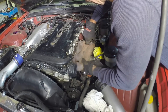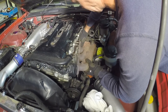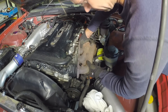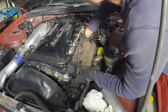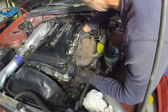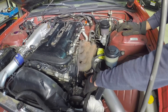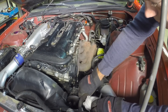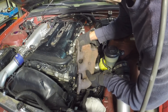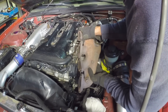Now, the entire turbo manifold and O2 pipe should slide right out, and in most cases it will. However, in my case, the added wastegate dump tube is in the way, so this was a no-go attempt. I actually had to remove the power steering pump, which then gave me just enough room to twist and fiddle the whole setup out. As you can see, it's still really a tight fit. There's always the option of removing the O2 pipe, but it's a pain with the assembly on the car, so I find this is the easier method.